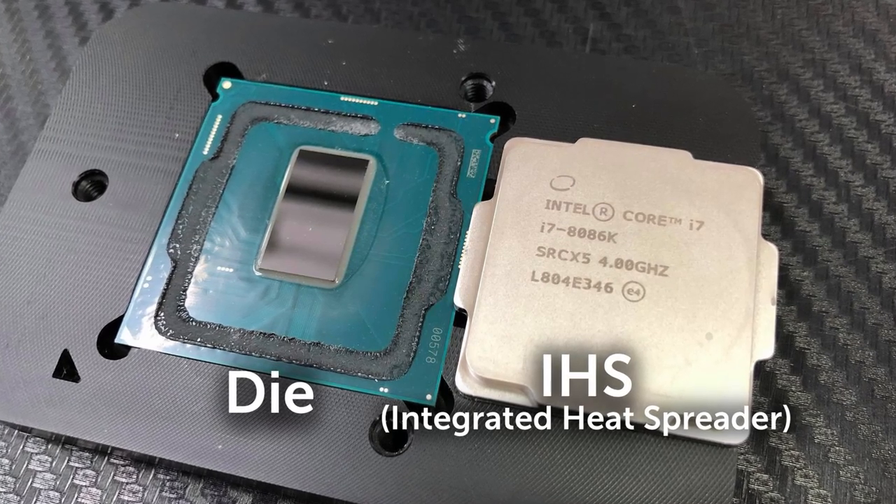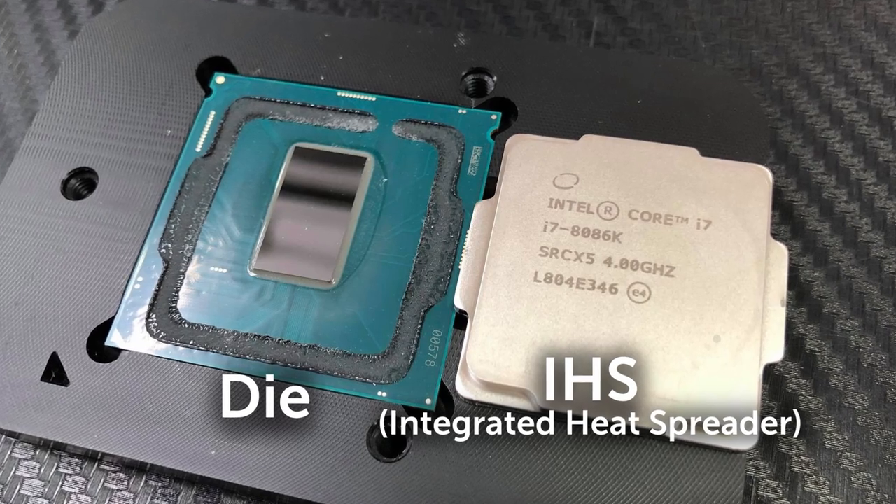Currently to date, my laptop is working perfectly fine — thank god — and the results shown above are from this application. I'll admit that a lot of issues I encountered were due to my inexperience with applying liquid metal, but I can assume that most people trying it for the first time might make the same mistakes, especially on a laptop rather than a desktop chip, where it's usually IHS to the cold plate instead of die directly to the cold plate. I want this video to be a word of caution if you decide to try this on your own machine, as things can go wrong and there are risk factors involved. If you get someone with experience or a professional to do it, I'm pretty sure the results will amaze you.